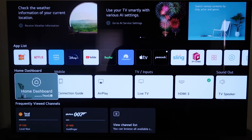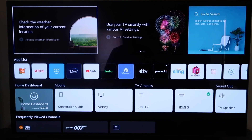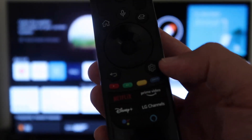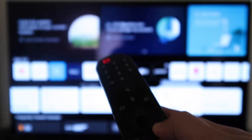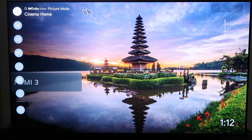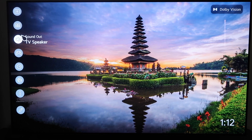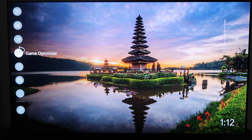I'm going to show you the step-by-step instructions on how to do that. Right here I'm on the dashboard to the LG TV. One of the easiest ways to do this is right here on your remote control — go ahead and click on the gear icon and that'll bring up this sidebar menu. Every LG TV might be a little different, but go to the one that has the speaker icon right there that says Sound Out.